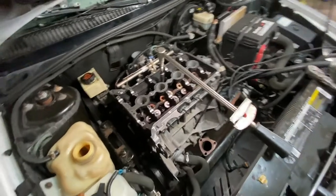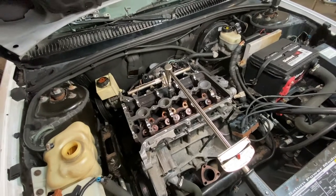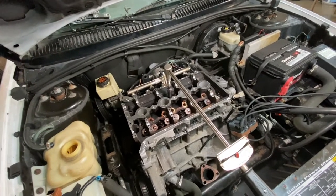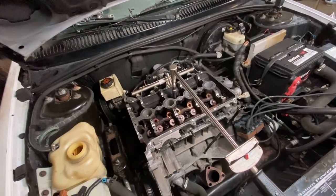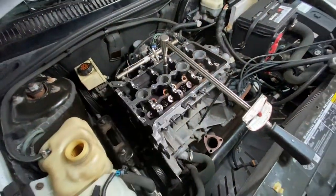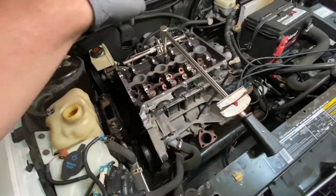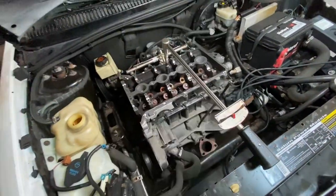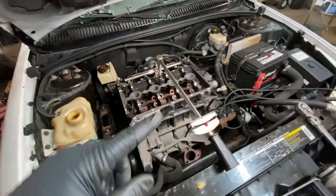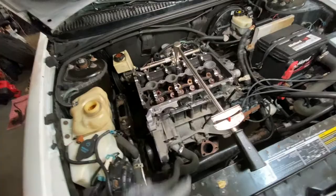Now, what you're going to do is tighten the bolts in sequence to 35 pounds. Then you're going to take them all out and oil them again. Not so much, just a light coating of oil. And then you're ready to torque them. So now you're going to torque them in the same sequence, starting with number 1, to 22 foot-pounds. Use a torque wrench, okay? 22 foot-pounds, you do 1 through 10. Then you do it again from number 1, to 37 pounds, in the same sequence.